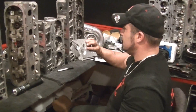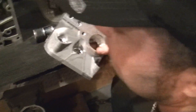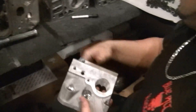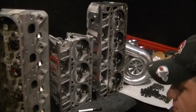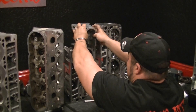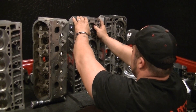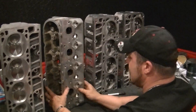This is a 241 SPM cast cylinder head — obviously the triangles, which are exactly identical to those triangles, even to the ridge. Same exterior cast. On the 241 heads, I'm going to reassemble this. This is an LS1 head out of like a 2000 Camaro or a Firebird WS6 2001 — this is the original, this is 98, 99.